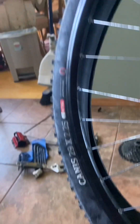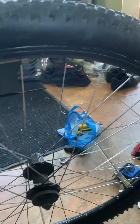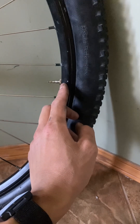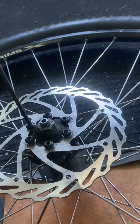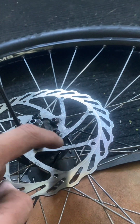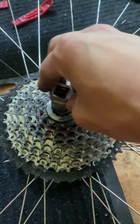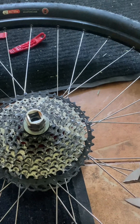Put the little metal ring on to secure the valve — you'll need to use your hands to force it in, but it will go in. After forcing it in, pull on your valve and tighten the ring even more. Once the tire is well inflated, make sure the ring is tight and the valve is nicely closed. Tighten the six rotor bolts in a star pattern — one, two, three, four, five, six. There is a special pattern on the freehub, so align the cassette correctly and turn clockwise with the adjustable wrench to tighten it onto the cassette hub.